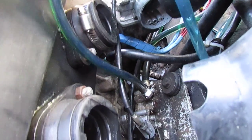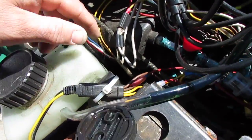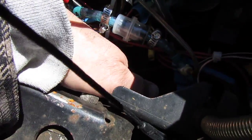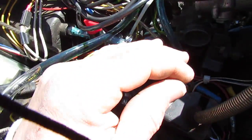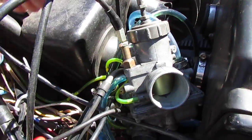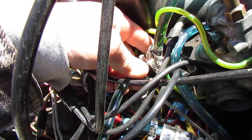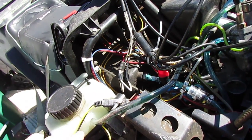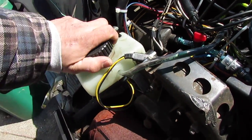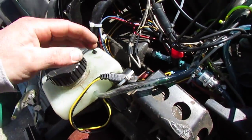One of the nipples broke off, so I needed a new check valve, and I wanted to test it. I replaced the line between the oil tank and the oil pump with a brand new tube. From the check valves you'll see this line here — there's another one down low — that goes to a T, connecting both check valves. I used clear tubing so I could see the action when I fired the sled, and I ran a return line out of that T right back to a hole I drilled in the top of the tank. That lets me watch the oil as it pumps through and see how it's pumping.